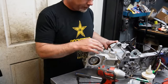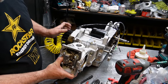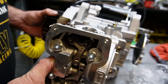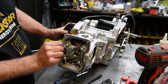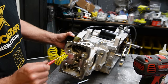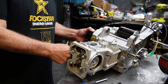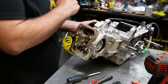Gonna go ahead and roll it over by hand once. Now I got the tensioner in, everything's torqued down. I want to see how smooth she is. Nice. Look for top dead center. Check my cam. At the top, so she rolls over pretty good compression wise. I can't turn it over. Couldn't turn it over, so that should be something.